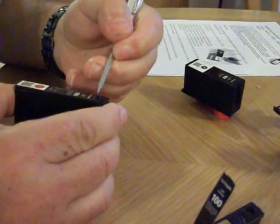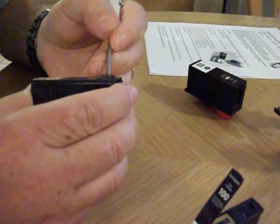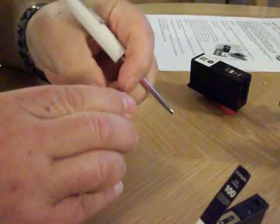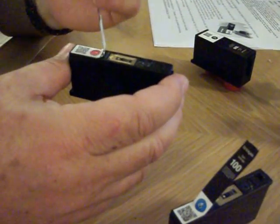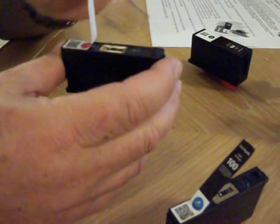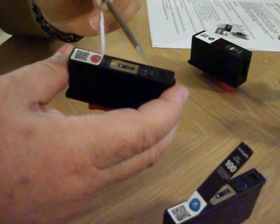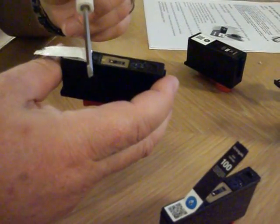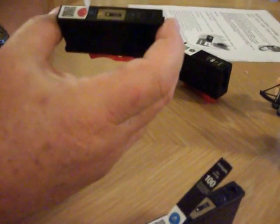Just to show you, I'm going to open up another one here. Changing out this one and replacing it with another used cartridge isn't going to do any good, because that one is empty as well. But you can buy replacement chips online. I just checked with a company — I'll put their information in the description — that will give this cartridge a new reference number, so the printer will think: oh, it's a brand new cartridge.